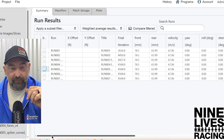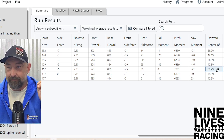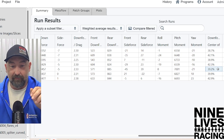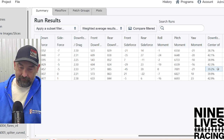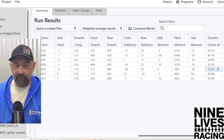I want to look at our overall balance. Overall balance before was 39% front balance, so majority of it was on the rear. We were calling that okay because it was close to 40 and the car has 50-50 weight balance — you want your downforce balance to match your weight balance. You want your front downforce to be within 10% of your overall downforce location. Because as you go faster, if it's off, your car will have a shift — usually right around 70 miles an hour. You'll get a definite flip of handling.